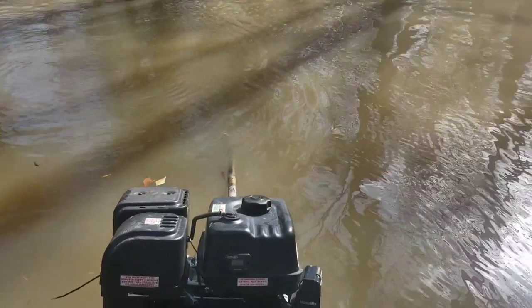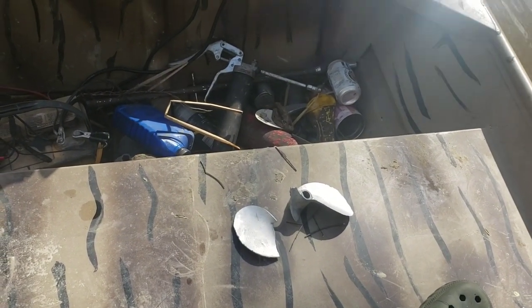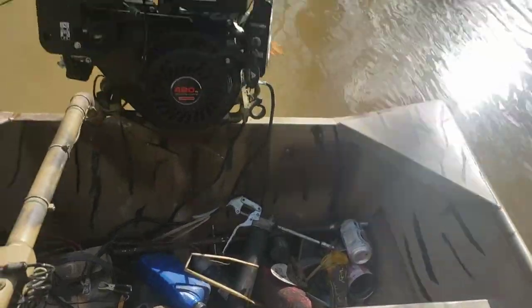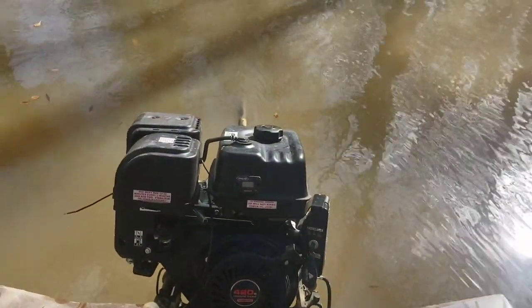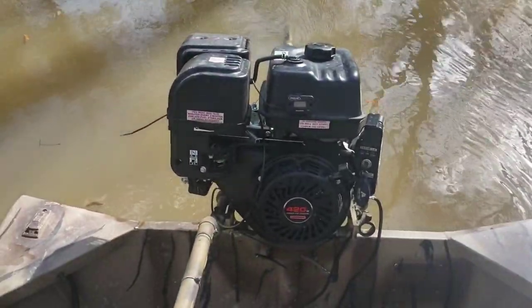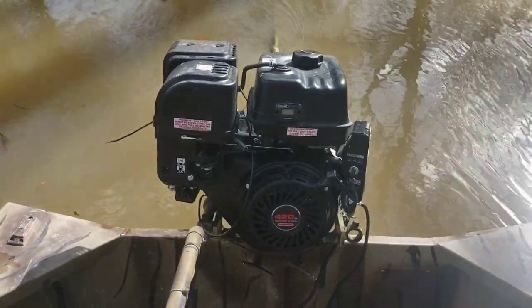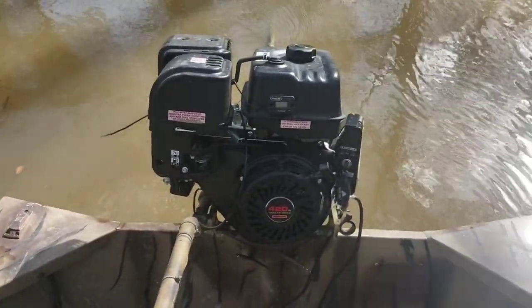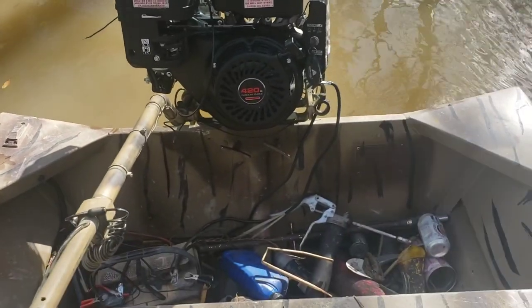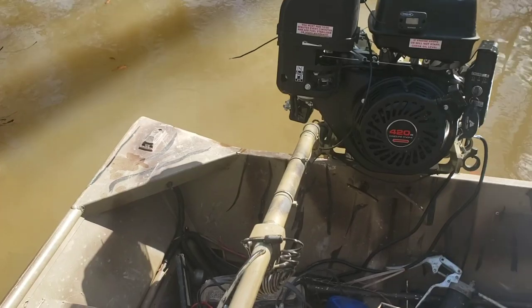And most of the people who sell the tie kits talk about that being the weak link. Basically the response I got from the guys at Backwater I talked to is, if you build the motor right, you don't need a weak link. You'll just seize up a motor. The motor will just stop, and then you can crank it back up and it'll run, is what they said. There's a lot of people run them, and I ain't heard of a whole lot of people tearing up a motor.